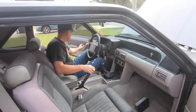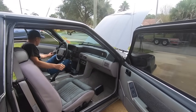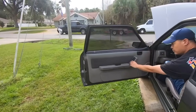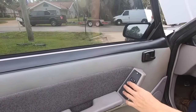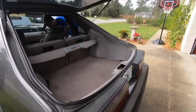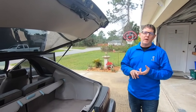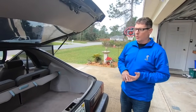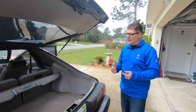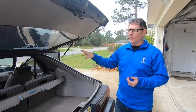Let's see if the power windows both work. The gear is bad on that one - it'll go down but the motor's struggling. That's going to need repair. The paint looks good, no sunroof - we don't want a sunroof. Anytime you buy a used car you want to check all the lights, brake lights, turn signals, the horn, the wipers - cover all the basics so you know what you're in for as far as simple repairs. We covered the Fox body trouble spots: the rust, the door hinges, and the door handles.